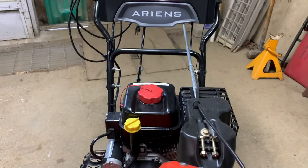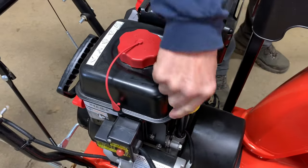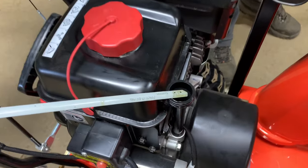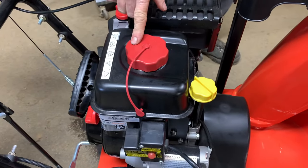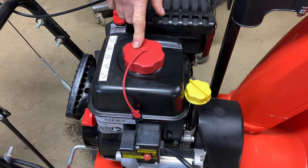The first thing you want to do is make sure you check the oil here. You just pull it out, unscrew it, check it, wipe it off a few times — it should be between those two dots. For gasoline, it is a four-cycle engine, so you're going to put straight gas, high octane if you can, unleaded, and if you have non-ethanol, it's even better.